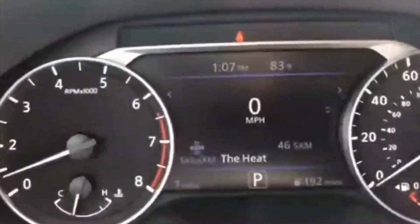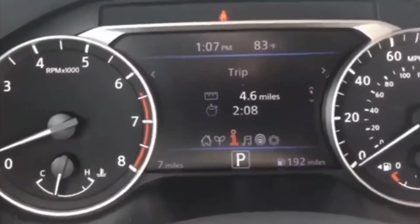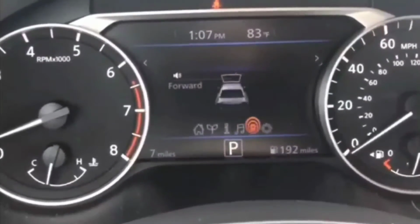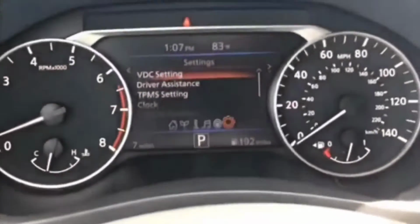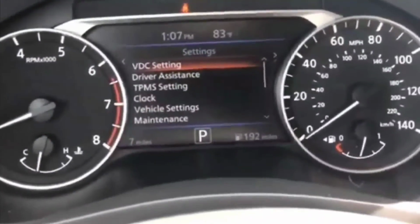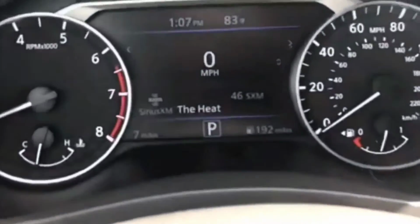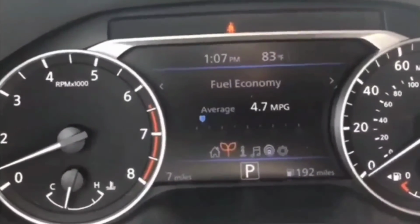I wouldn't say fix it, but if it doesn't start up, you guys could try to click it manually a couple of times and then try to start it. But I had it working, and got it started up. Drove to AutoZone, got another brake switch, swapped it out, popped it in, and that was it, guys. Quick fix.